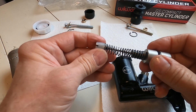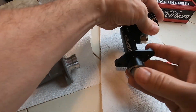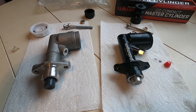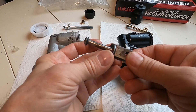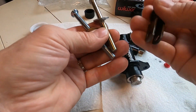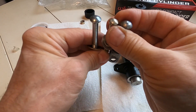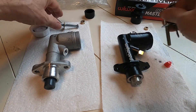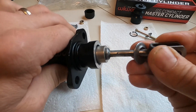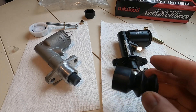Another thing I was concerned with is whether I could use the push rod from my Gypsy. The Austin Gypsy uses a specific push rod and I imagine other British cars use different ones. The Wilwood comes with a generic push rod — they both do — but as you can see it doesn't have that little yoke on there to fit onto the pedal. The push rod end that presses against it is pretty much the same, so that fits as well.